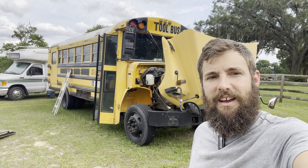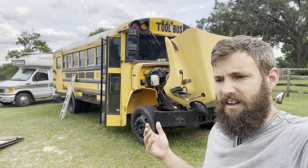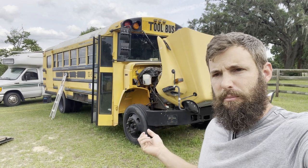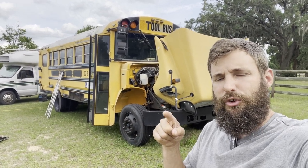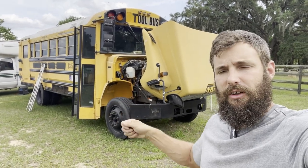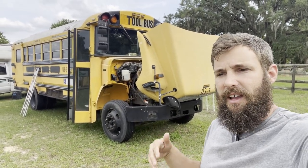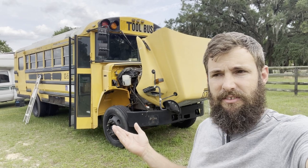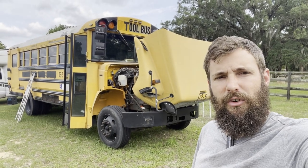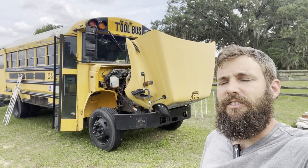While this video is not designed to be an infomercial for the easy valves, I think you can see why it makes a lot of sense. For people who are traveling full-time on the road, you're able to pull up to an AutoZone or something, purchase the new oil. You're going to have your old two-and-a-half-gallon jugs — slide them underneath, open the valve until the jug's full, remove that jug, put another jug in, fill that one up, and now you've emptied the bus without a mess. You've got complete control over the flow of the oil. With a cartridge filter up on top like on these Mercedes engines, it's a wonderful thing.